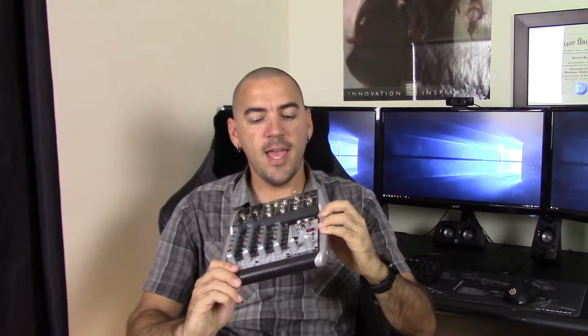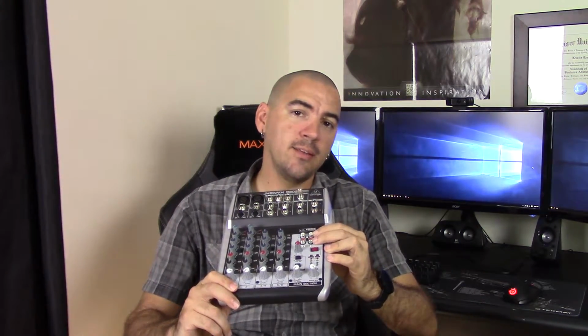So I got to thinking about it. I'm like, why don't I use that? So that's exactly what I ended up doing. I ended up putting my sound card back in. It has a line in. I went with the RCA out to 3.5 millimeter mic into my sound card. Hiss was gone, the hum was gone. It sounds glorious. So if you have a sound card with a line in or some other equipment where you can use that and not need the USB, definitely go that route.